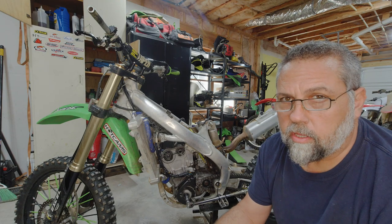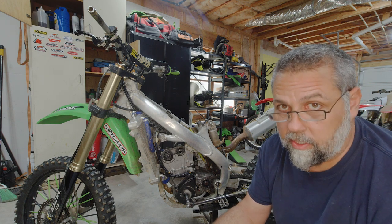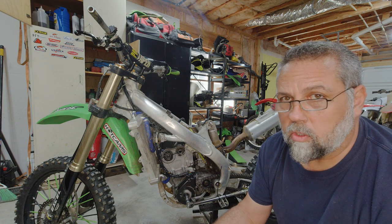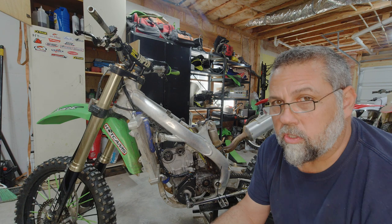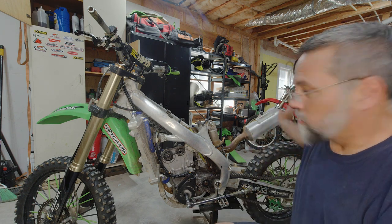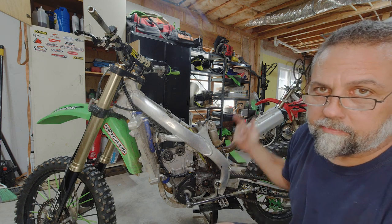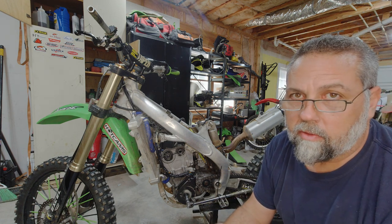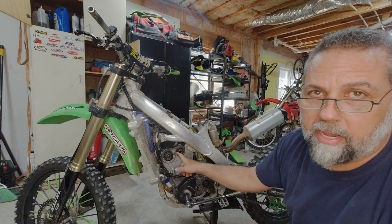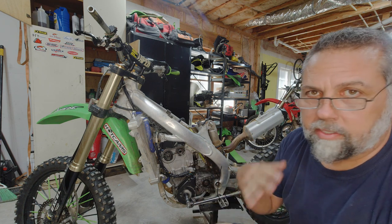Now keep in mind, I mentioned the things that I thought it was. Obviously, a leakage like that could be other things, including intake and exhaust valves not seating properly or leaking to the cooling system or something like that. The reason I didn't mention those is because doing the leak down test, I put my ear up against the exhaust, the intake, and the cooling system, and no air is coming out. The only air that I hear coming out is out of the crankcase itself. So that's a bypass of the cylinder head gasket, or the rings, piston, something like that.